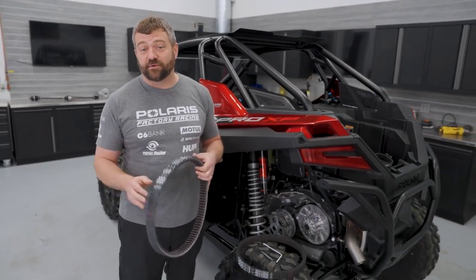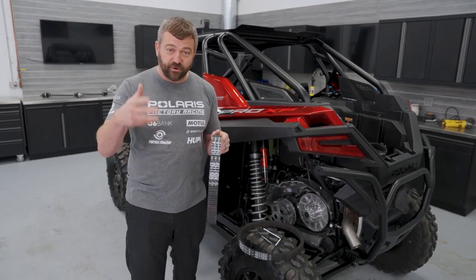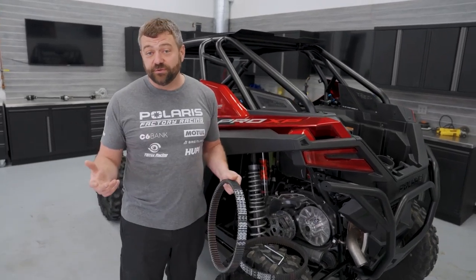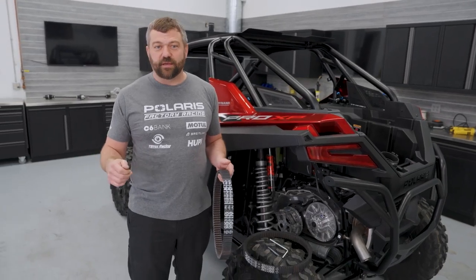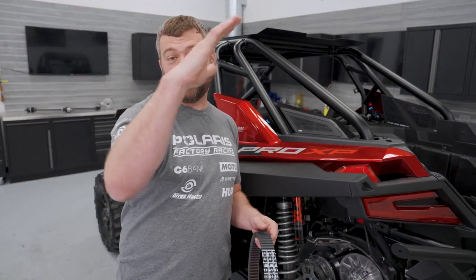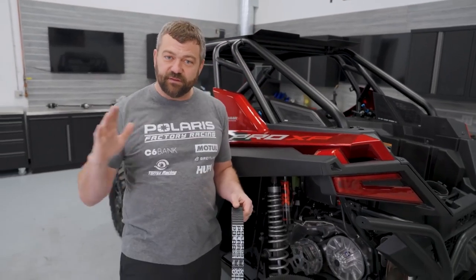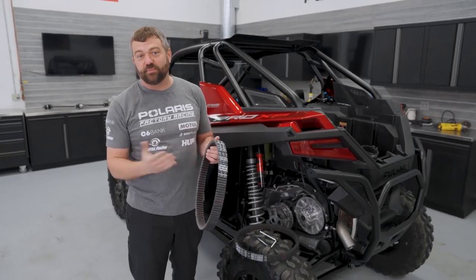In real technical terrain, be in all-wheel drive. Make sure you keep it in low gear when you're going up and over obstacles. When you're running in dunes, all-wheel drive is your best friend. Think of two-wheel drive like a boat when someone hits the throttle and it's starting to auger in pushing that bow wave, and all-wheel drive like a boat coming up on plane - it's just a lot less load and it's going to be easier on your belt.